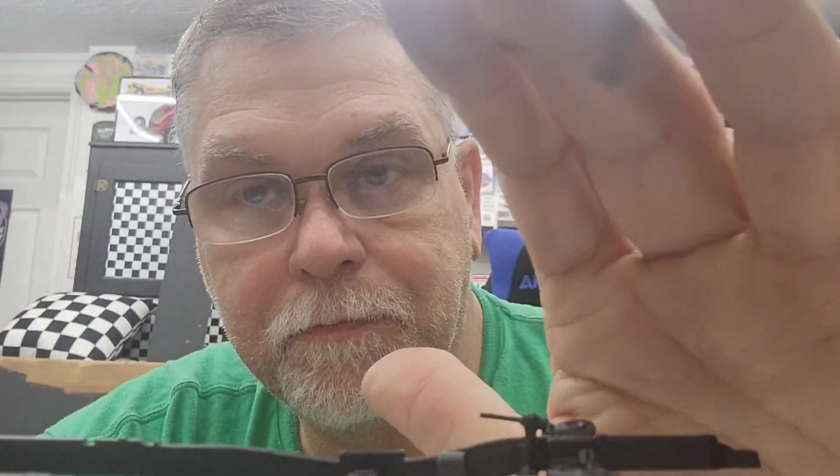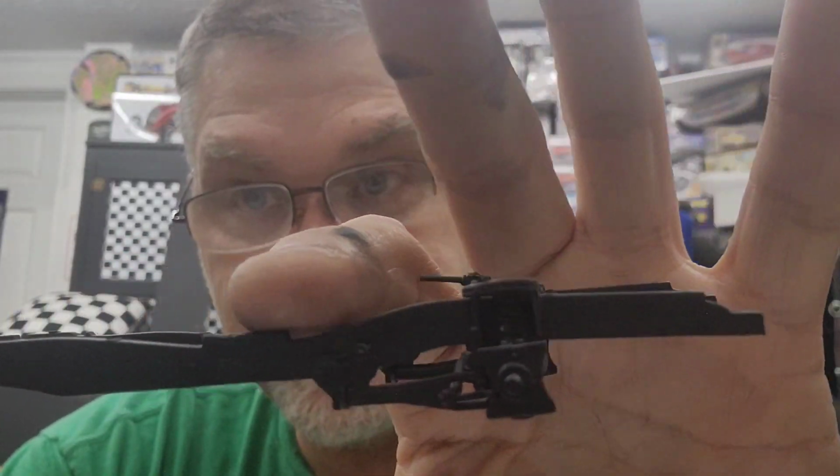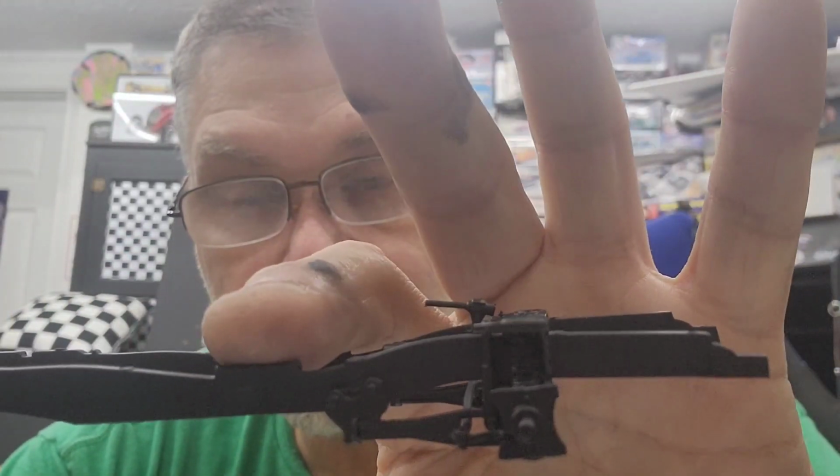That's why you want to slowly move your weight forward. Only when you see that tire hit the table, that's where you stop. You don't just keep going. That's what it took for me to get it, right here in this little saddle. And then finally the tire touched the ground. This was weighted down. I lightly heated it again while the tire's touching, and let it cool back down right where it's at. Pop. No warp. So it's just a thought you might like.